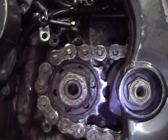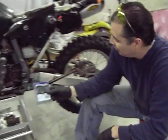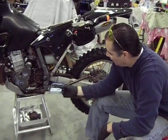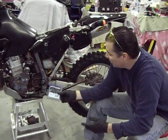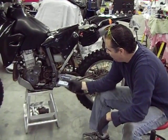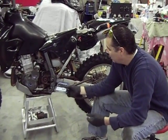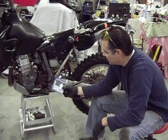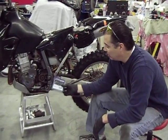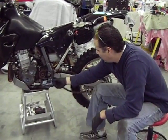So what we have done — we thought about this long and hard — and we got him a new Renthal front sprocket. The stock teeth on this bike is a 15-tooth front sprocket according to everything that we found. We counted the teeth on Everide's and he has a 14-tooth front sprocket, which lowers the gear ratio and gives a little bit more torque. So we're simply replacing the front sprocket with the same tooth count that he had originally, which is a 14-tooth. We've got a Renthal sprocket that we're going to put on there.